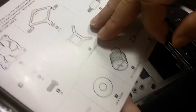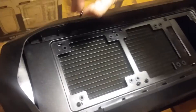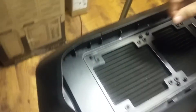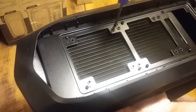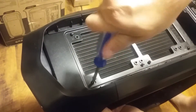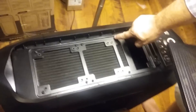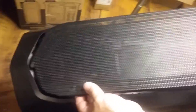Just to show you — we're using these E-screws with the little washers, and that's how we're securing it to the top of the case. We've got most of them finger-tightened. Now it's just a matter of using the screwdriver and tightening things down. You're trying to secure it enough so you don't get a lot of shaking, since the fans are a major source of noise. Securing them nicely will reduce the amount of noise somewhat.